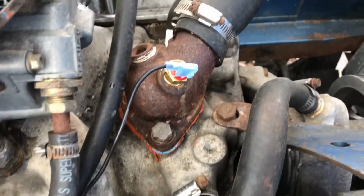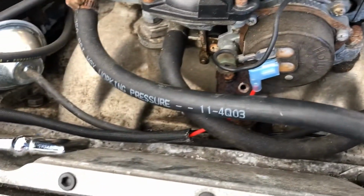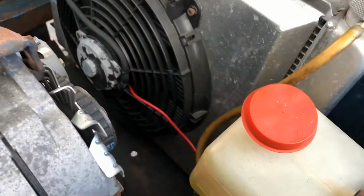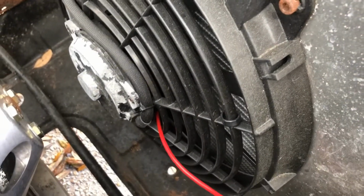The fan switch relay is wired in. New switch with the connector. Have the choke wired in. The switch and the choke run through the same sleeve. The relay was recommended to be as close to the fan as possible. Still have to wire this in, but I think this is about the only wire left in the engine bay. Well, besides what needs to go to the gauges.